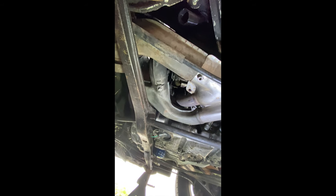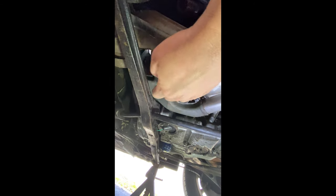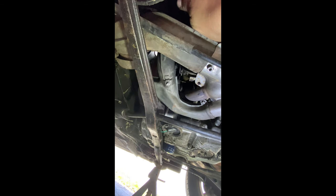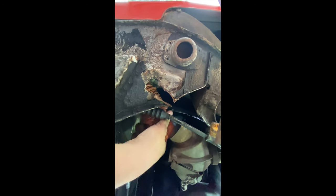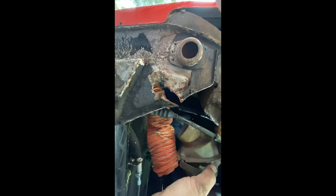We have our tin back in. There are several pieces you have to deal with. This is the first piece — there are two bolts here and two bolts at the other end, and these both have straps across the top. Next, put in the J-pipe that goes up to provide the heat. I recommend you put the pipe in loosely, secure the bolt from the top, and then do the one from the bottom. Last, you'll do your piece with one bolt here and one bolt on the top that comes over to your heater valve. This car is going to be getting some new heater valve hoses soon, so we're going to get this back connected. It's a little long so I may trim it so it gets a little bit better. We'll put that pinch bolt in and we'll be able to have heat as much as we need it — or defrost down here in Florida, more likely.